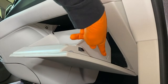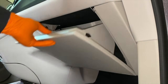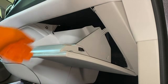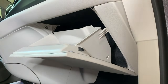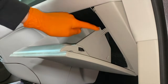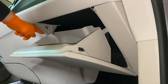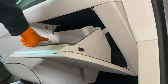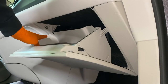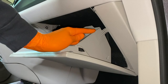From here, there's that cutout as you see right there. And the glove box itself is no longer held on with that slow closing or soft closing feature mechanism. It basically just falls as shown there. From here, we can carefully push in on these side panels and release these hooks from the inner panels on either side. And DIYers, we have found that this one over here, or the left side, is a friendly shift and removal. However, coming to the far right, this one is pretty stubborn and may test your patience.